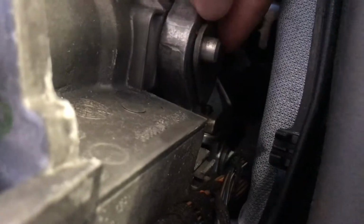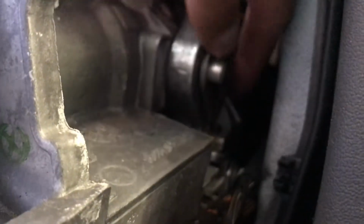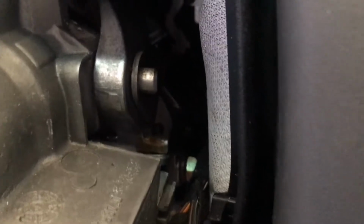This piece here, you just gotta pull the little retaining clip off, and then next we need to remove the nut or the bolt, which I've already done over here in the back, and then we're gonna remove this retaining clip. We're gonna do that on both sides, but first, as you can see right down here, that bolt sticking up is preventing this retaining clip from coming off, so we just need to get underneath it here. And it's a 5mm Allen head. We're just going to loosen it up just a little bit so that we can slide that plate off.